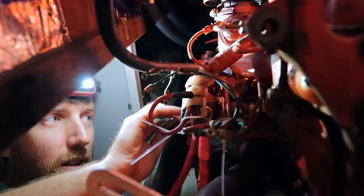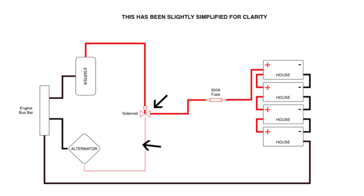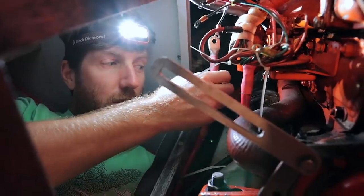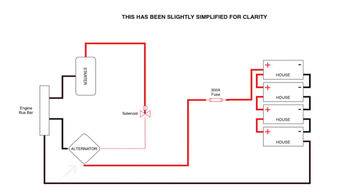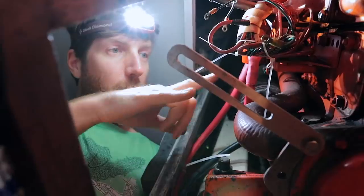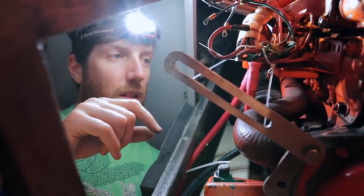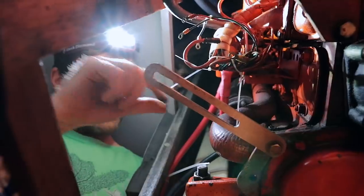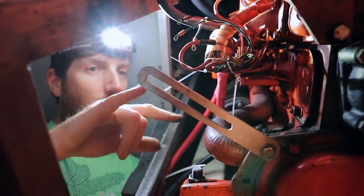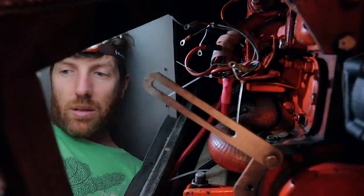I'm slightly changing the way that this is going to be wired. Our big, thick battery cable coming from the batteries used to go to the solenoid and then jumped over to the alternator via a much thinner gauge battery cable — this is a 1-0 and that was like a number two. Now I want to connect this directly to the alternator and then jump back to the solenoid via that thinner gauge cable, which runs to our starter. Because it's such a short cable run, it won't have much voltage drop, and the starter only runs for 20 seconds at most. Whereas we're running the alternator for a very long period of time — if that current's constantly going through that little cable, it will heat up, causing resistance, which will cause it to heat up more.